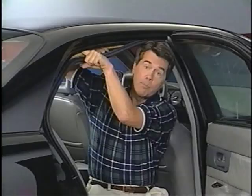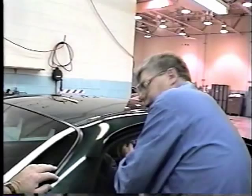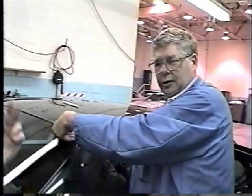With this on it here, okay? Yep, and you put it in. Yeah, you put it in this way, and there's a panel that goes down there. You'll feel like an overlapping panel. You slide it underneath, put it right there, and put the soap on it, and you'll see it leaking. You'll see it blowing out the back end. So that's between the inner and the outer roof panel.